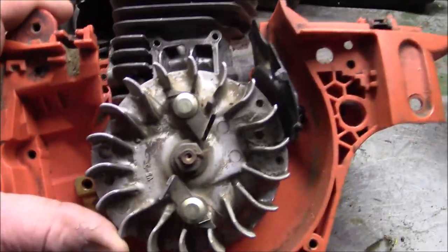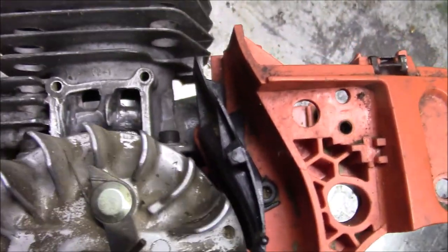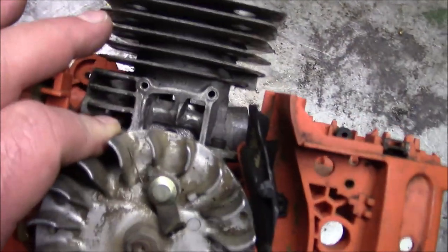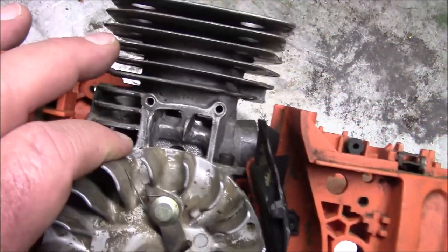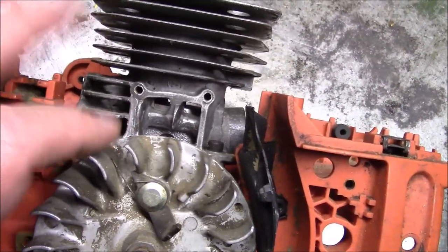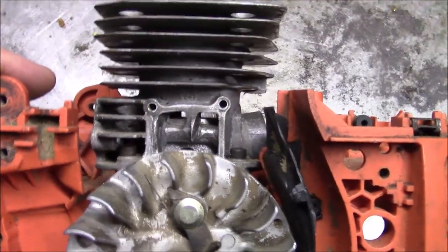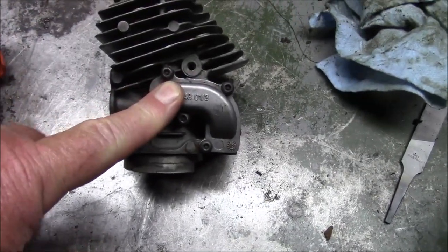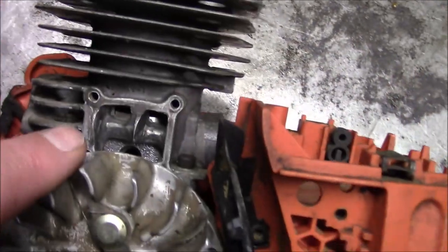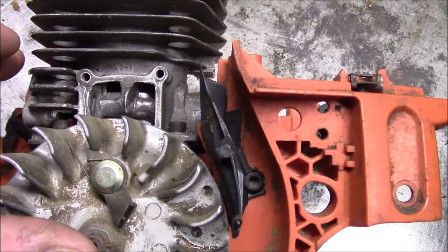Just a little point. People argue about it, but think about it. Just think about what happens when the gas air mixture hits that at bottom dead center. And actually, opening up the transfers to get cross-sectional area makes a huge difference on RPMs. And like I said before, what you're losing with less than optimal blowdown numbers, you're more than making up because of the cross-sectional area increase. And then you have these cylinders with the caps, which just makes that modification a lot easier. Instead of having to reach in there with a small angle grinder, you can just reach in from the side. See what I'm saying?